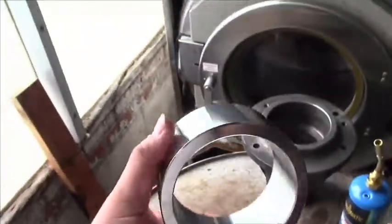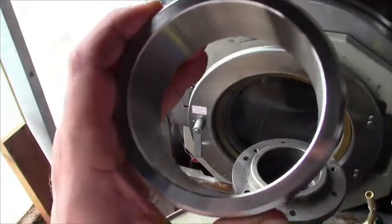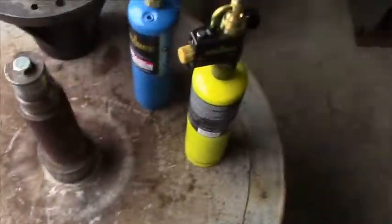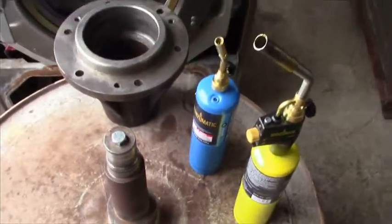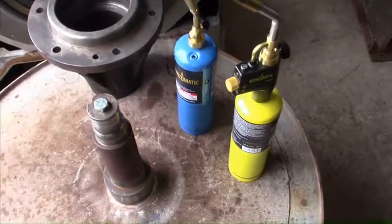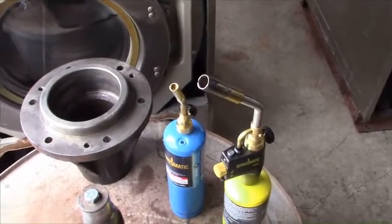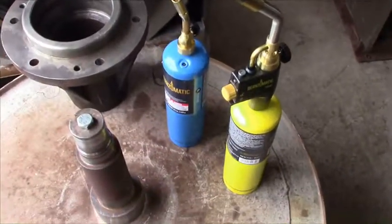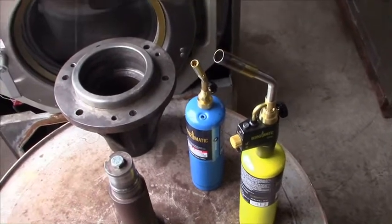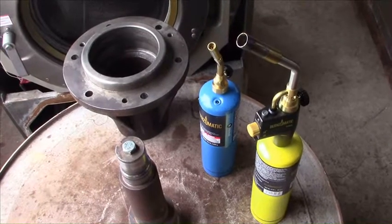First thing is to put this stainless steel sleeve back on. They make it a very tight fit. You have to heat this up to get it to expand and go on there. I have a map gas torch and a propane torch. They say use 2 map gas torches. I say a second tank of that yellow fuel plus the burner tip to run it is a lot more expensive. Propane isn't quite as hot, but it's hot enough. And you know how Loudmouth Tim does things. Almost as good and a whole lot cheaper.